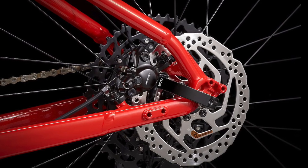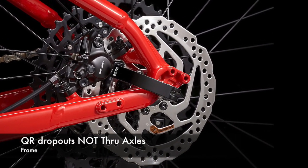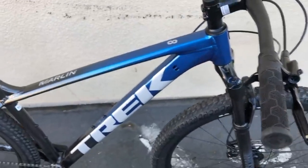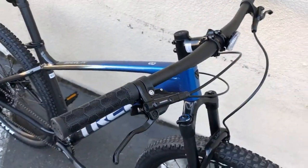The frame comes with standard mountain bike 135mm quick release dropouts. Note that these are quick release dropouts and not through axles, and being a 2022 model, I'll dock a few points for using an older standard. Another interesting bit about the Marlin frame is that the head tube is non-tapered — but I'll come back to that later.